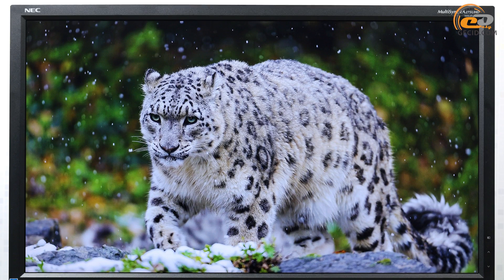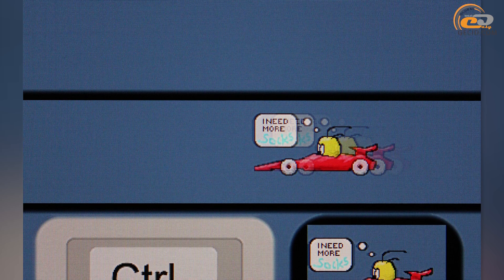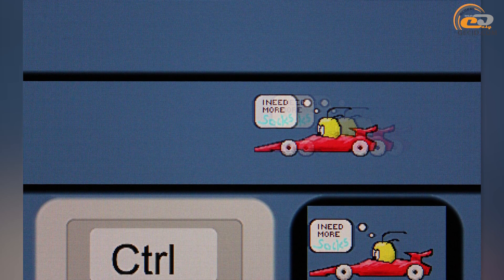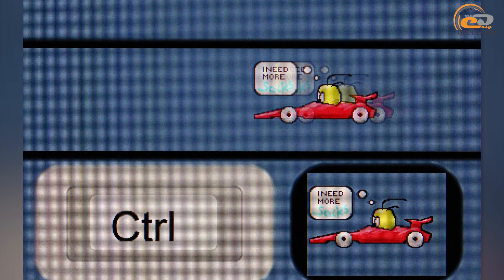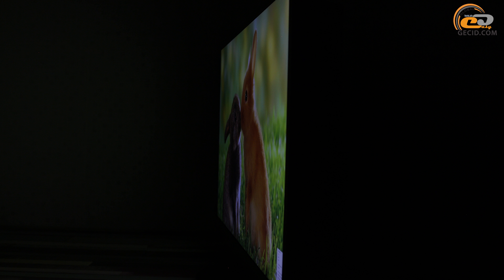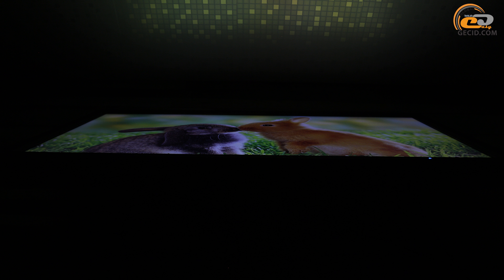The fill test did not reveal any crucial problems. Small backlight leaks can be observed around the screen on a black background only, but they do not significantly affect comfortable viewing. The NEC MultiSync EI275UHD uses an IPS matrix with a claimed response time of 5ms, and testing confirms rather high speed of operation. The loops of small moving objects are small and artifacts are missing, making this display unit suitable for dynamic games or movies. The monitor implements IPS viewing angles of 178 degrees, although an uncomfortable whitening and yellowish tint was observed when viewed from sharp diagonal angles. These are untypical viewing angles, and the ergonomic stand will help adjust the most comfortable screen position.